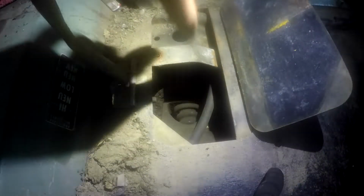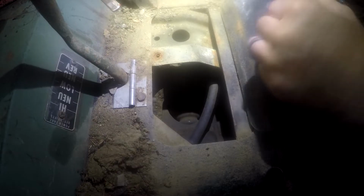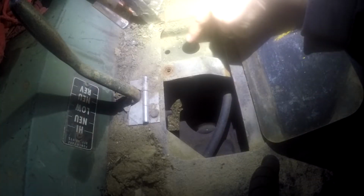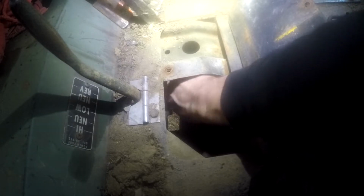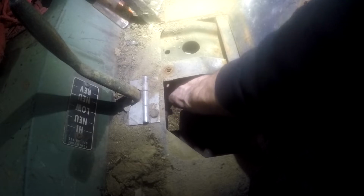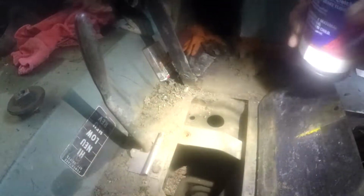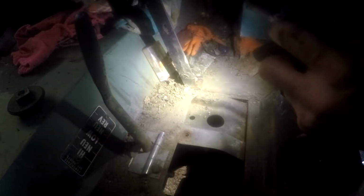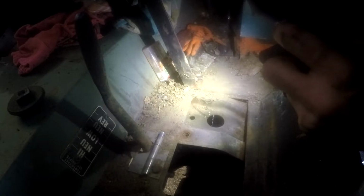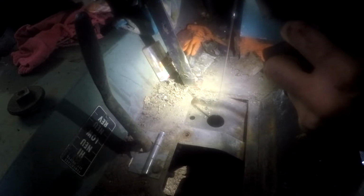And this whole thing here is the master cylinder, basically. I'm not gonna try to explain it any better than that right now, but I gotta get down here. That's where you pour the fluid. There's an air line attached to it that I have to undo. Alrighty, she's just a slight bit low, so we're gonna add just a little bit. It's a trick, you gotta do the real long pour with this. Or get a funnel like a normal person, but I'm not normal.